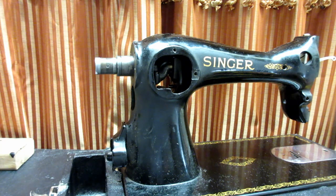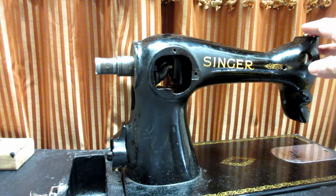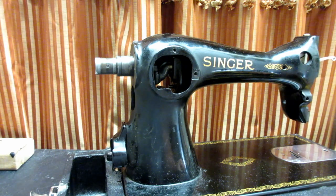This is AndyTube. In this video, I'm going to show you where the crank connection rod cap oil pad felt is. I've never seen one of these before. And after I found oil pads in the presser bar and the needle bar, I started looking real close at the parts list, and when I'd see these little things that were small and not smooth and didn't have a screw cap, I'd investigate, and sure enough, I found more oil pads.